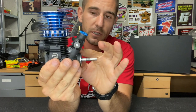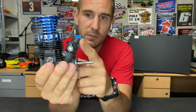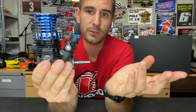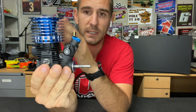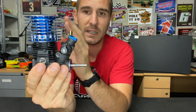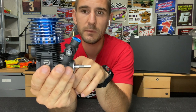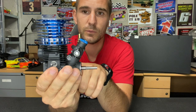As you can see, the new carburetor has a new inner and outer diameter with the crankcase. So the crankcase has been changed. Unfortunately, you can't use that carburetor on previous versions of the P3X. The crankcase has been changed but the internals are the same — same crankshaft (not DLC, just regular), same piston sleeve, same head button. The crankcase is also a little bit different inside because the carburetor diameter is slightly different, so the channels inside are modified to make the fuel flow really well into the engine.